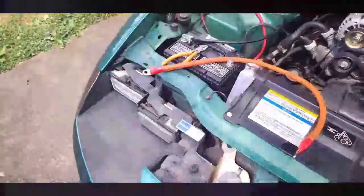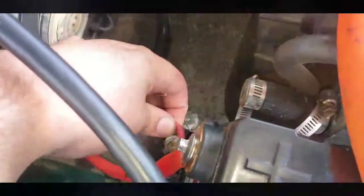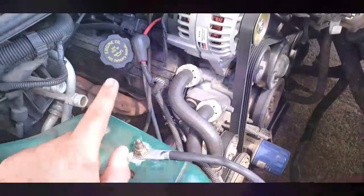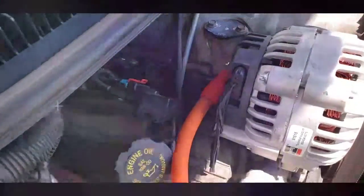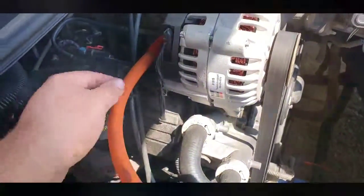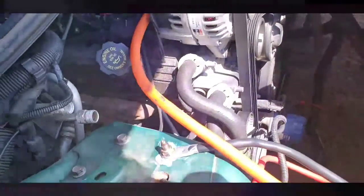What I can do is cut it from here and bolt it from the back of the alternator. I'm going to unbolt it first and make sure this isn't too big and isn't just flopping around — don't want the nut to fall out or anything. Looks like it's going to work out pretty good. I'll keep this piece here just so vibrations don't wear a hole through the insulation and cause a really bad short.